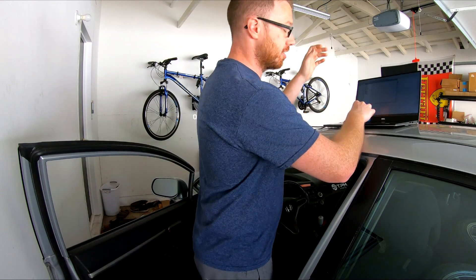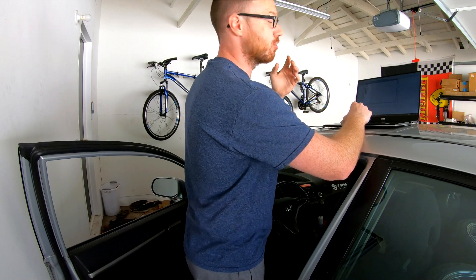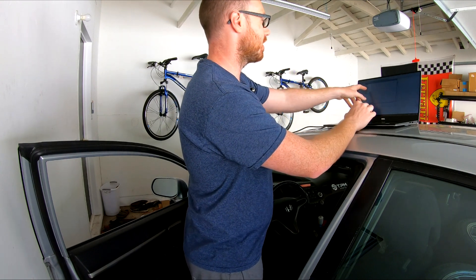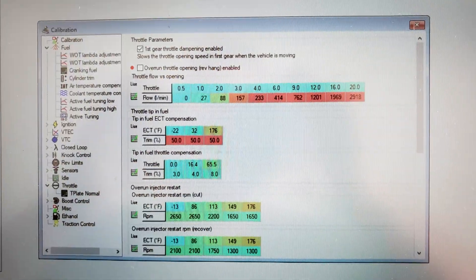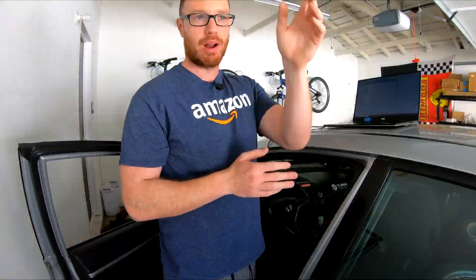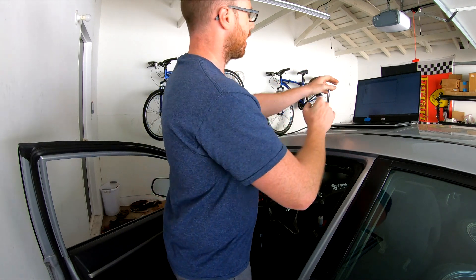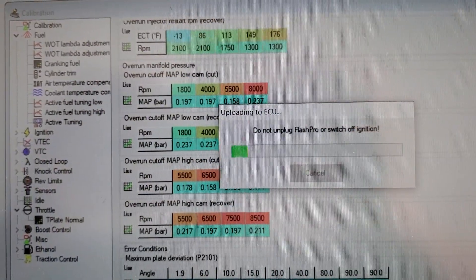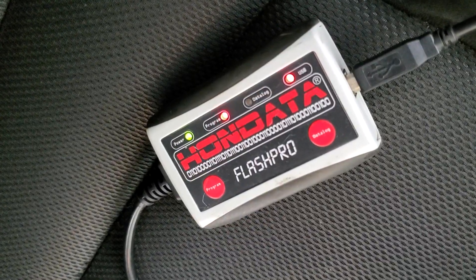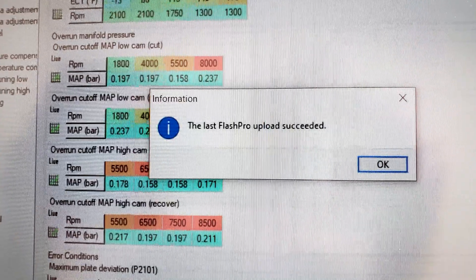For the street drivers, this is really where I think things become important — and that is drivability — because there is an option on Hondata to delete rev hang. If you've driven a newer Honda product, you know what rev hang is: when you clutch in, the revs linger before dropping. It's really hard to build a rhythm up with these cars because of that. Hondata claims they can delete the rev hang, and that should improve drivability substantially. So I'm going to get this flash onto the ECU — that should take 30 to 45 seconds — and then we'll have the ECU flashed with our stock tuned map and go for a drive.